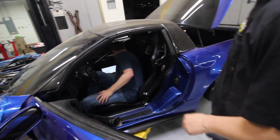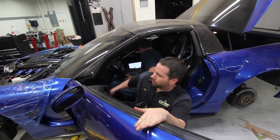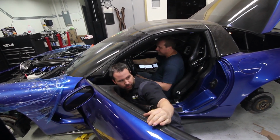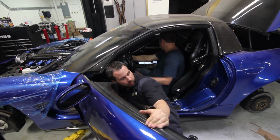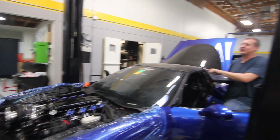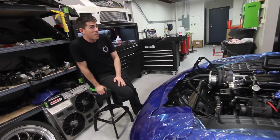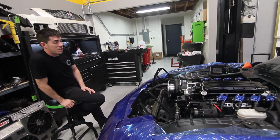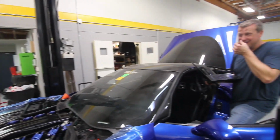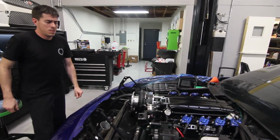It's fine. We know it runs, has oil pressure. Okay, let's do it one more time. Thank God it has oil pressure. That's the part that freaks me out the most, even though I've never been let down. No, we've hit the max airflow allowed in the computer. Keep in mind we've got everything scaled down to a third, and I can't add any more.